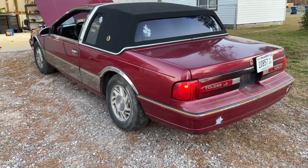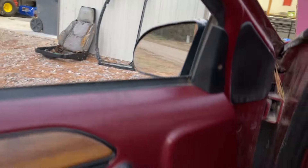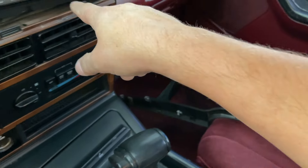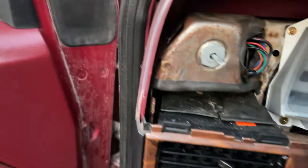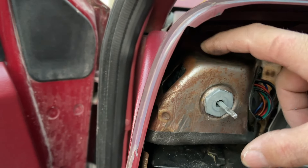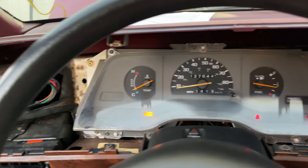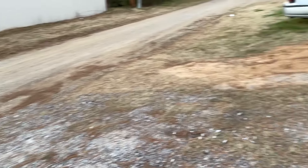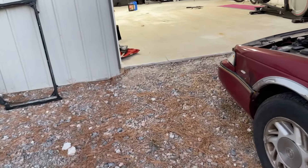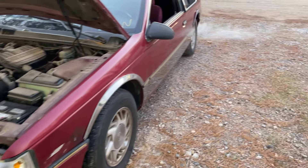So I'm going to let her sit here and run a little more. I took the liberty while we're waiting to go ahead and fix those headlights. This comes off with only two screws and a bunch of clips, so no big deal there. The little nut that holds the headlight assembly in place — the headlight switch had come undone — so we've got that back in. The temperature is starting to go up but mainly we got the headlights to go out, so I'm going to call that a win. Another quick fix — got the lights off now.